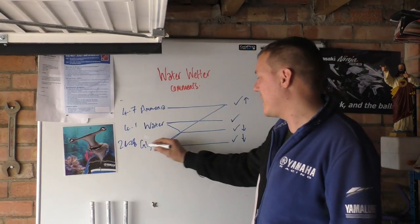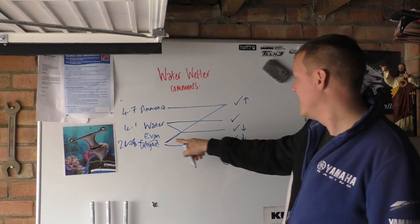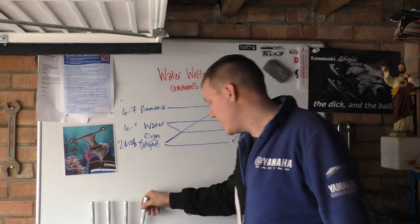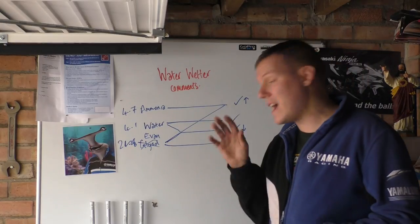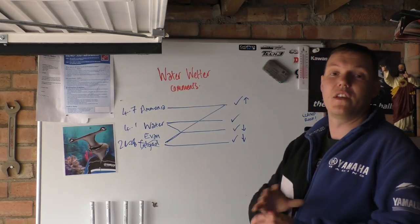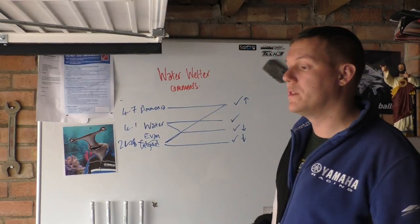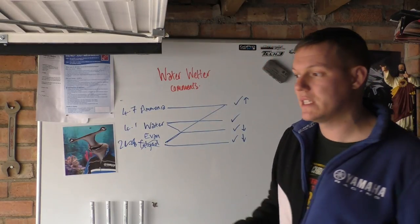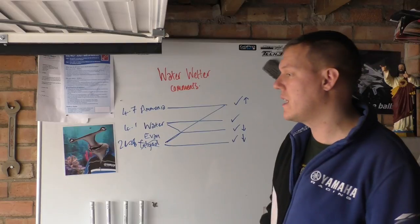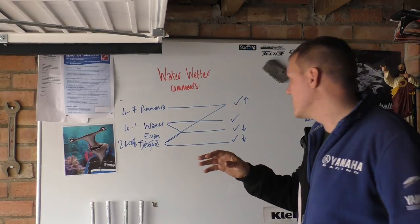You know what I mean? Forget the glycols. If this was Evans, it is a glycol. It's shit. We'll do it, this is what I mean. I'm going to prove it to you. The SV is going to get some Evans. It's going to cost me a fortune for stuff I know I'm just going to empty. But we are going to dry out that system like you've never seen. Basically, I'm going to empty the system and blow it through and then use a heat gun, well, basically a vacuum hairdryer, and we're going to blow hot air through the entire system for a couple of hours.